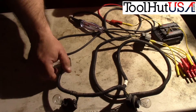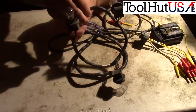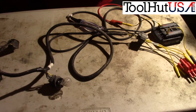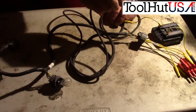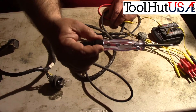What I've got here is a simple circuit with three bulbs and simple connectors for a headlight assembly on a Silverado. Let's say we're at a salvage yard and we want to check the integrity of this harness before we purchase it. All we need is a small battery — you can use a nine-volt battery, or one of the 12-volt lantern batteries used for camping.